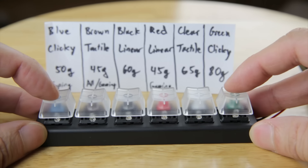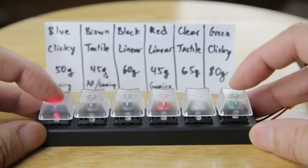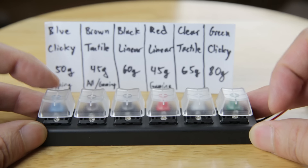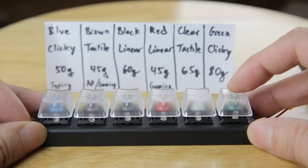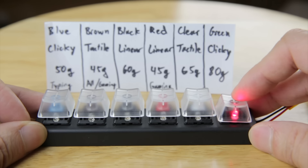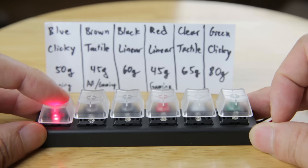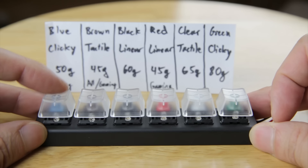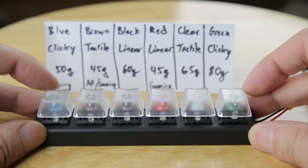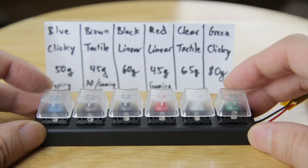The next ones are the blue and green Cherry MX switches — these are the clicky ones. You can hear the clicky sound. The blue is 50 gram activation force and the green is 80 gram. Again, the green is a little bit too heavy, but maybe for people with really heavy hands they would want it heavier so they don't accidentally activate a switch. If you're in an office environment, you really don't want a clicky one because every single key you press is going to go click, click, click — you might annoy your coworkers. So you might not want to get a clicky one for an office environment and go with something that doesn't click, just maybe a tactile or even the red like me.